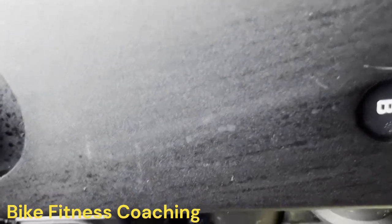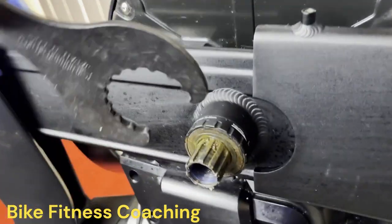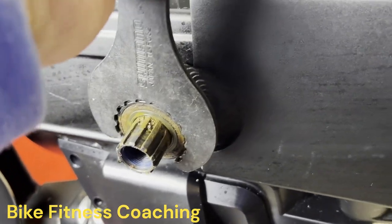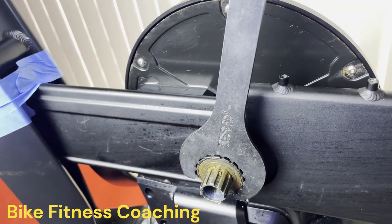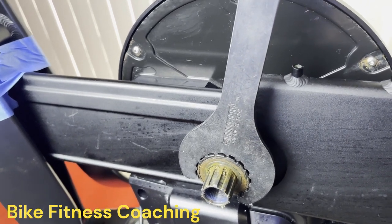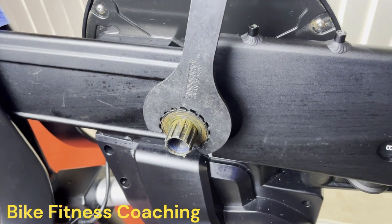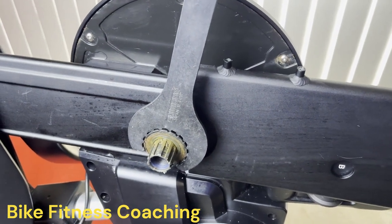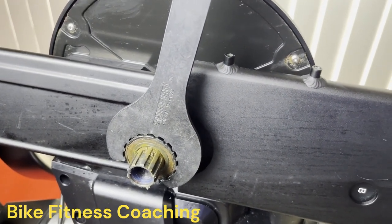And now, the way the tool works is, always, if you are looking at the bottom bracket shell itself and the bearings, the cups will rotate. You'll rotate the tool forward to loosen. So the non-drive side, you will turn it counterclockwise to loosen. The drive side, you will turn it clockwise to loosen. Both bearing cups rotate forward to loosen them up and to remove them, and rotate backwards to tighten them. Exactly opposite of the pedals.